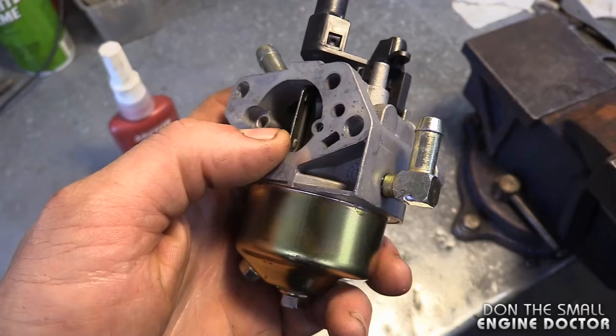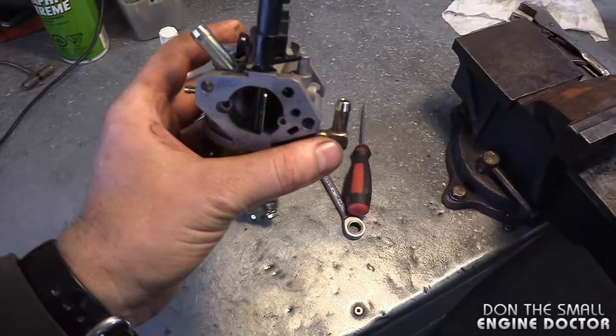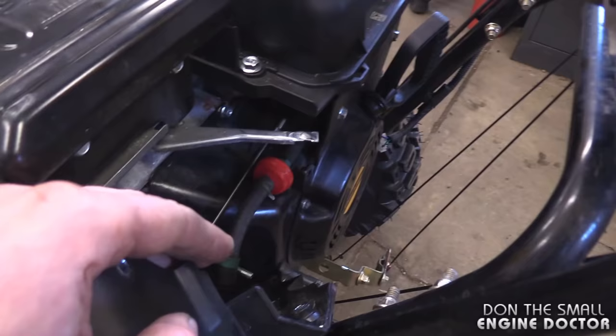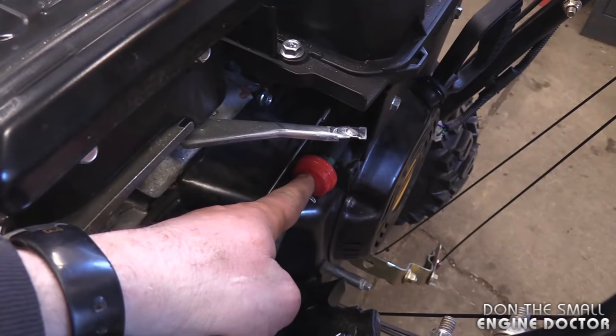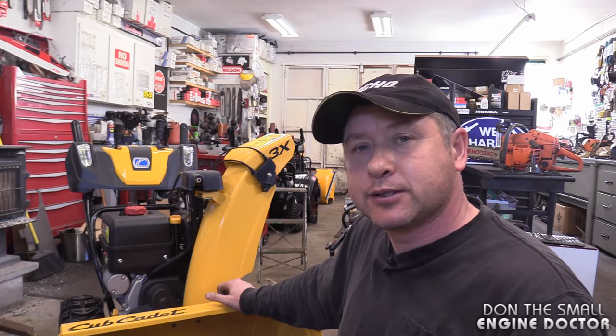That's where that screen is hiding. If you have any equipment not running properly, make sure to check that. A lot of people replace carburetors when the only culprit is a dirty little screen. If that screen is slightly dirty, your engine will be starving for fuel under load. Many people ask about adding an extra fuel filter to prevent this — yes you can, but only if there's room. Most engines have a screen in the fuel tank in addition to the carburetor screen. On this snowblower there was room, so I added an inline fuel filter. This isn't just a snowblower issue — you'll find that screen in many carburetors. Thanks for watching and please comment below if you've run across this issue before. Have a great day!